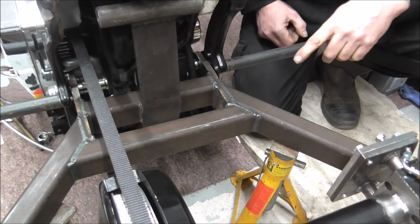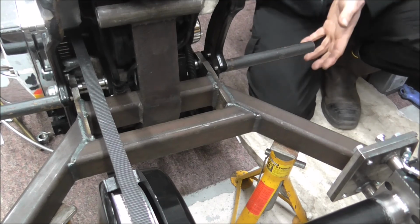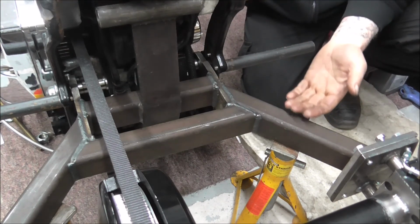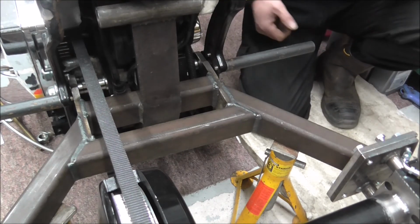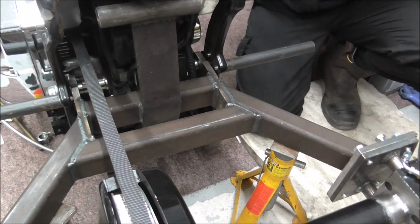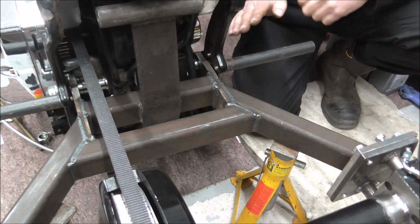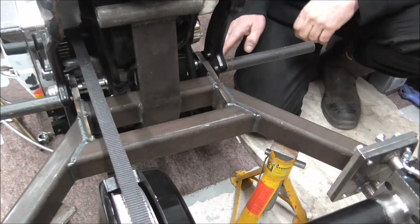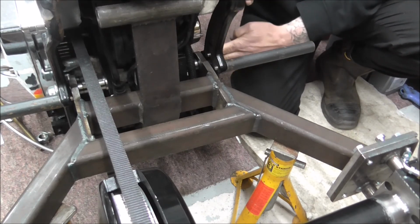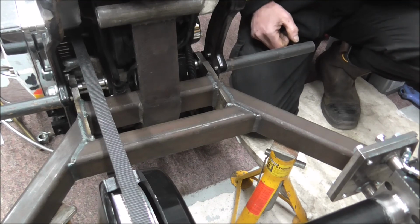Talking about exhaust systems, I offered the Thunderheader system up to see if it would go on with this swing arm, and it won't. It's going to foul on the swing arm, so I've bought another exhaust system. That was the thing I couldn't remember the other day when I was mentioning bits and pieces that I'd bought. So I've bought a short system, like Vance & Hines short shots, but they're not Vance & Hines. Where the Vance & Hines system cuts off tapered, these are just two pipes flush, like shotguns. But you'll see them when I get to putting them on.